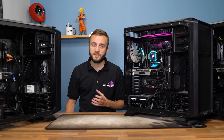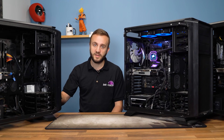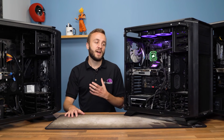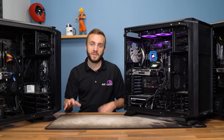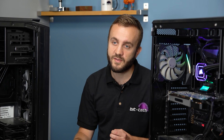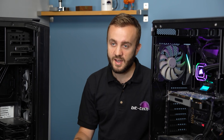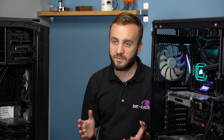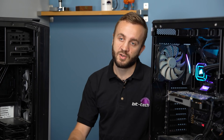We install coolers in cases to mimic a real-world setup with a typical front-to-back airflow pattern. Fans are fixed in terms of speed, each CPU is overclocked to provide a fixed frequency and voltage — it's about minimizing variables. For the test itself, we run a 15-minute run of Prime95, record the maximum core temperature, and account for ambient temperature using Delta T, which is what you'll see in the graphs.